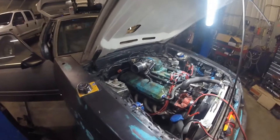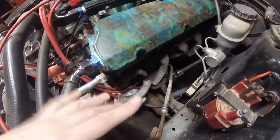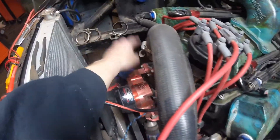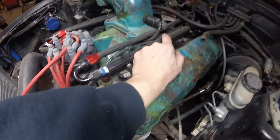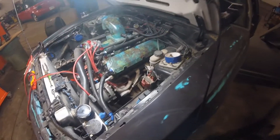Just like that - that was awesome! So clearly we found what the issue is. Now we got to get all this crap out of the way. We're gonna get the hot side on, I'm gonna get a ground strap made to go from the block to the chassis, also gonna get the ground strap to go from the fuel injector harness to the chassis, and we're gonna start wiring in the cutout switch for the battery. We're gonna have this pig on the road.